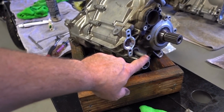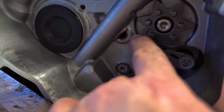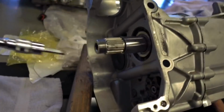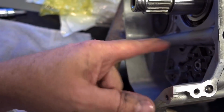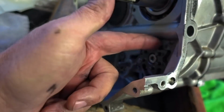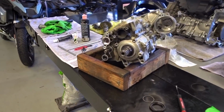And it's all controlled by that lockout arm I was showing you guys earlier. What it looks like on the shift drum is like a second neutral position. This is actually neutral there. And I should be able to switch it into neutral without turning. Yeah, now she's in neutral. And then the remaining gears, that'd be first, second, third, fourth, fifth, and sixth. That's that. She's together.